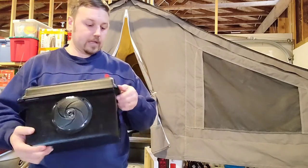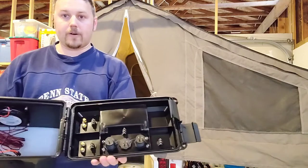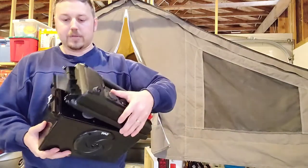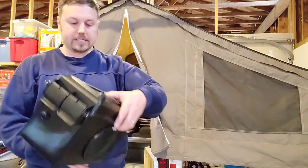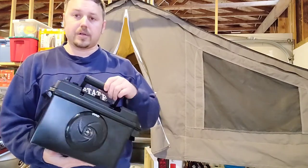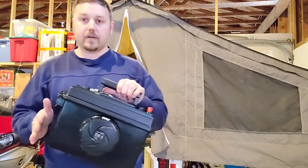Right now the inside of the box is clean and orderly, oriented the same way so all our negatives are away. I have the speakers mounted — you can see the speaker wire there. I'm just waiting on my batteries. I went with lead acid batteries for now to keep costs down, doing two 12-volt 9 amp-hour batteries wired in parallel, giving me 18 amp-hours at 12 volts.